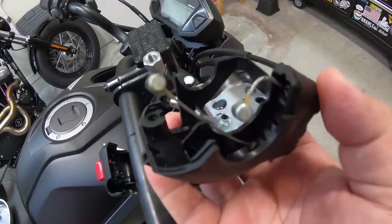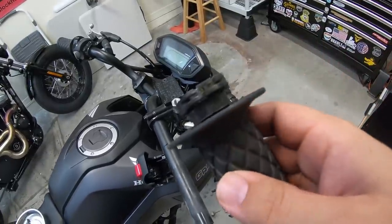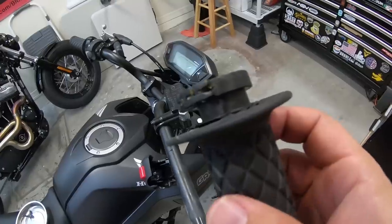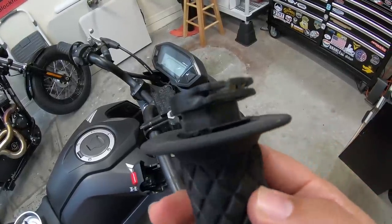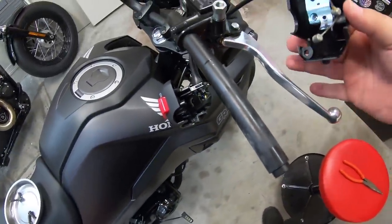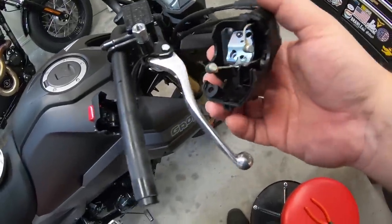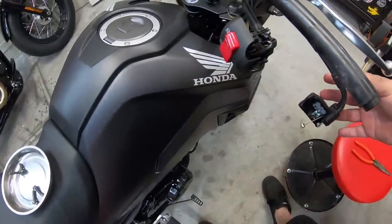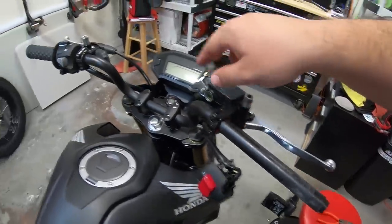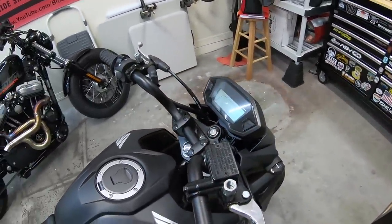For the throttle, those two pieces thread into the throttle tube and each fit inside the little channels. It's cool that they're connected — on a Harley those little pieces can fall off, but here everything is retained. Just hang that downwards, and then the next part is removing the lever side and the levers on each side.